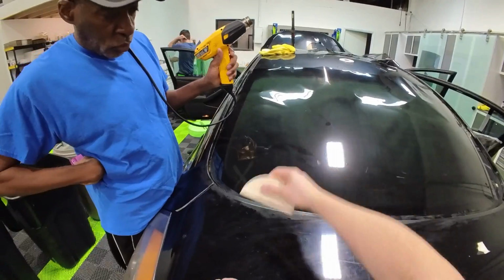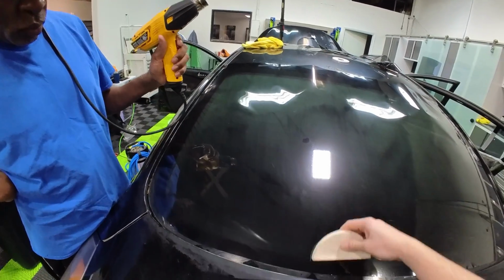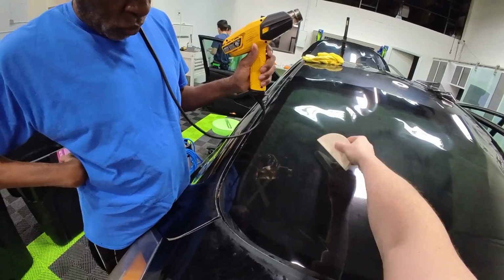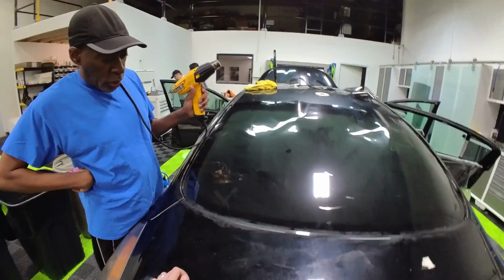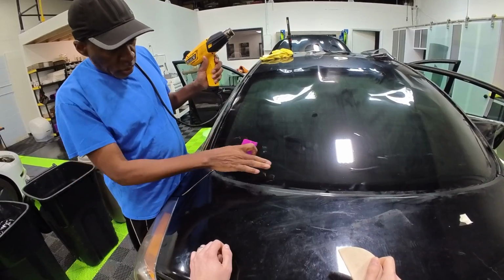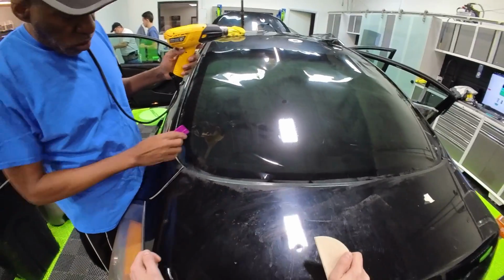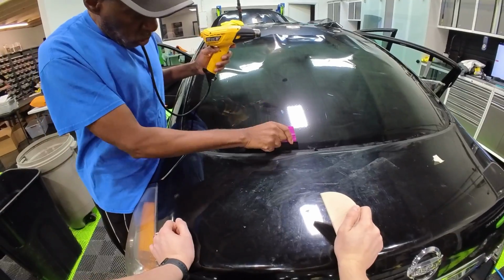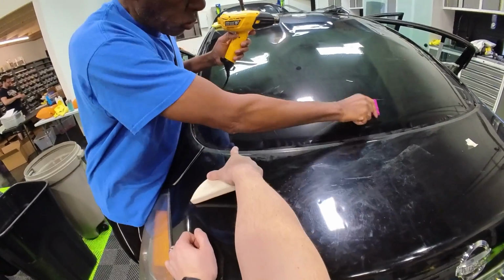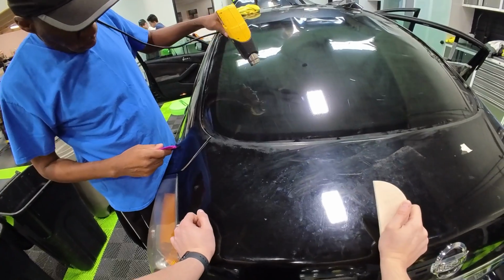So you've got to stretch the film over the window, and that kind of starts from this area, straight forward, and then these tend to go out the corners. Okay. Yep. And same thing happens for the top. Okay. So that's pretty good right there. I could go and push that down, or you Yeah, you can push that down. You have maybe a very slight amount to shrink right in here. So this little bump that's over the edge, I would shrink that a little bit farther.